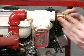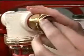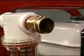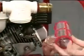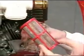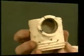First, check the inlet hose swivel to ensure the combination hose screen and washer is clean, in place, and in good condition. Second, check the inlet line strainer to make sure the gasket is in place, the mesh strainer is not clogged, and there are no cracks in the cap or bowl.